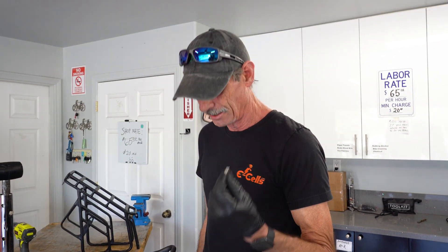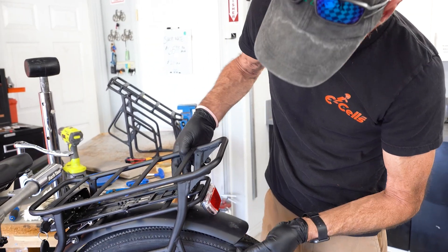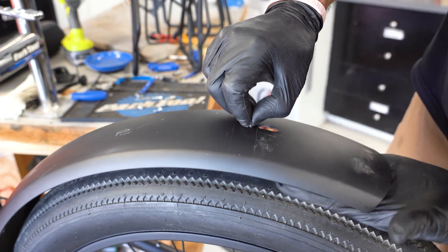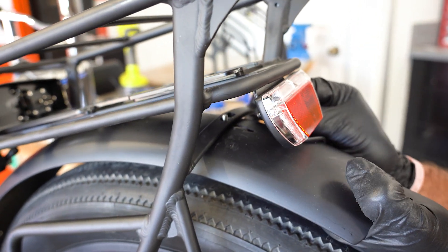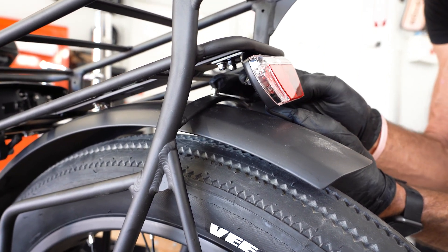Here's a little trick for you. It was hard enough getting this little guy off the first time — putting it back on and accessing it again can be a bit of a pain. I reverse it: have the head facing down in the tire area, and with the tire deflated it's very easy to access with your hands in there. If you put this screw on first before any of those rack bolts, it will save you a world of hurt and you can see how much easier it is to access the bolts and put it back together.